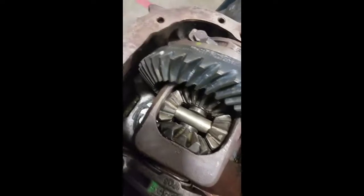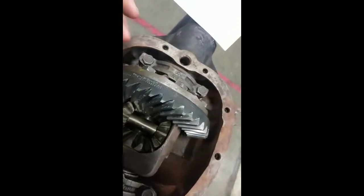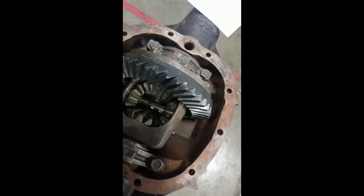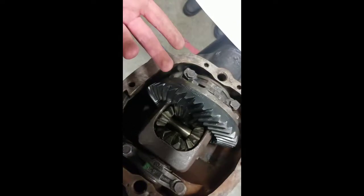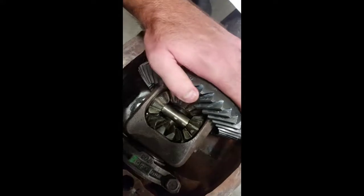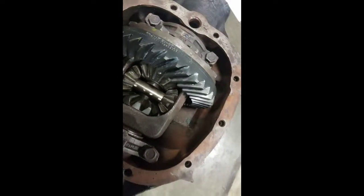You verify the complaints and look at the actual parts. With the splines, you also have to look at what year the vehicle is. After 1993, it's going to be about 26 to 29 splines. On a Ford, you're going to have about 31 to 33 splines. So if you get into it and realize someone's tried to put the wrong parts in there — mixed and matching parts — that's going to cause an issue.